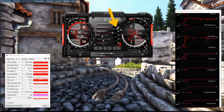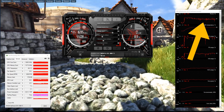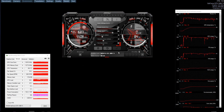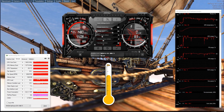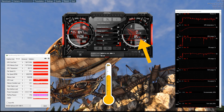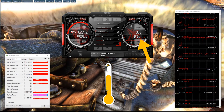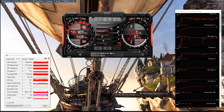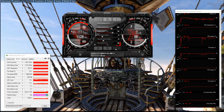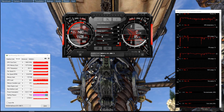If I were to raise the power limit, since the card is not actually hitting 100% anyway, it's going to make zero difference — it'll just give a little more swing, but raising the power limit alone won't cause major differences. If I were to raise just the temperature limit, because now my limit is 90 Celsius, it has more wiggle room. The boost clock is already a little bit higher because the thermal throttling doesn't kick in until farther on. Most people don't want to run their video card at 90 Celsius just to get the extra boost — they want the best performance within safe parameters.